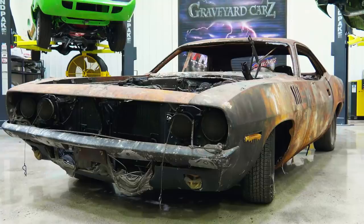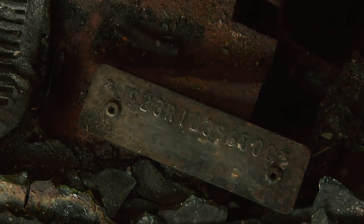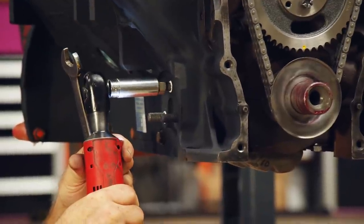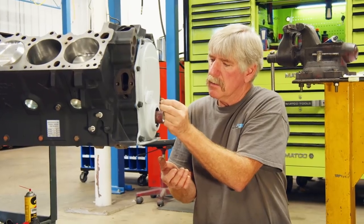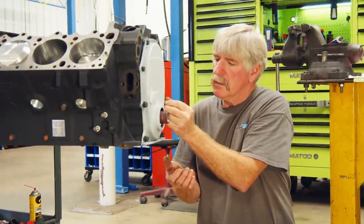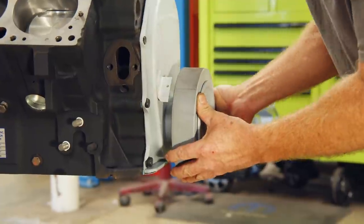The Phoenix Cuda is a 1971 Hemi Cuda that was burned beyond recognition — most of the metal was completely caved in from the fire. We're going to reconstruct this car. I'm pretty excited to rebuild this engine because it looks like a new engine now. I'll be using a lot of Hi-Tac Permatex gasket sealant because most of the gaskets we use can tear pretty easily — cork gaskets in the valve cover can snap in half, paper gaskets can tear or rip. Hi-Tac holds it in place really well until you bolt them together.